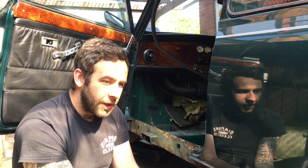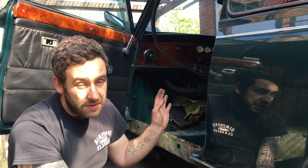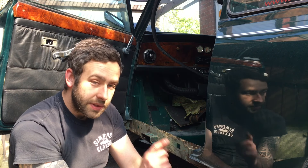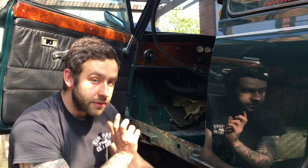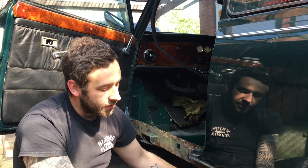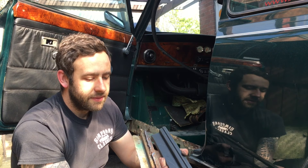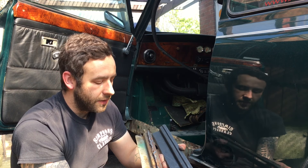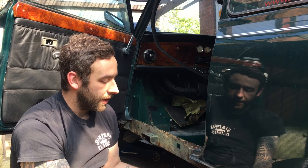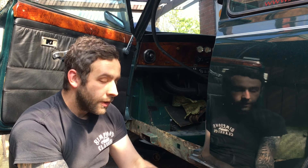If I was to be honest, it's a bit better than the other side but just as bad. There were a few repairs in there as well which weren't the best. And obviously where the drain holes are on the driver's side, we repaired those as well. It is what it is. But having taken this off — if I lay the two here — I mean, which are you going to choose? You might as well. I'll redrill the holes where the kick plate went but it's no biggie — I've taken reference points for where they went.